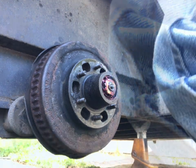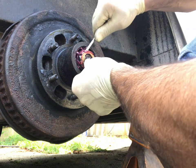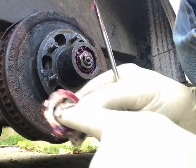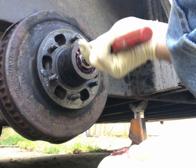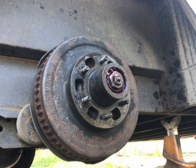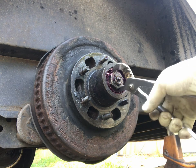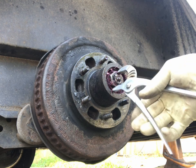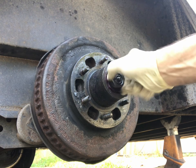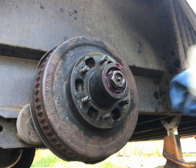There's a little cage — it wraps around the nut and has a slot that goes into a flat spot to keep the nut from backing off. Next step: got the cage off, you're just gonna loosen the nut. When putting these on, you basically tighten it and back it off a second. Thank God none of this stuff seized — when those bearings let go they seize onto the spindle and you've got to cut them off, sometimes even replace the spindle.